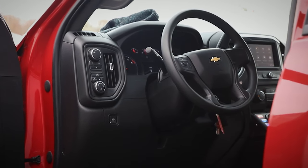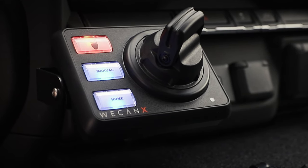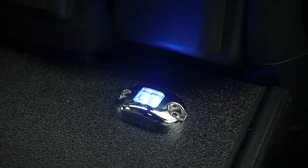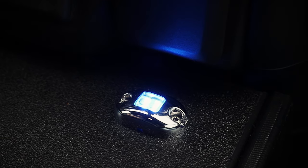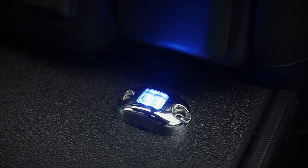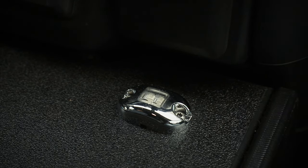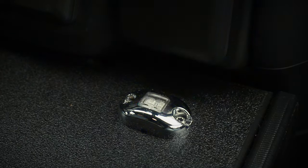Taking a look at the front cabin area, we installed Sound Off signal dome lights in the front and back. They're red and white with their own individual switches. We have our Whelen Argus controller, a custom-designed HDPE console, and a compartment door open indicator. What was nice with the Blueprint system is we're able to program the light to function differently. It does a steady on when the truck's parked, so it's not an eyesore or distracting for anybody sitting in the truck, it's just on. But if you put the truck into drive, the light starts to flash and becomes more visible to the driver, so they know that one of the compartments is open. That's flexible and can be changed however the customer wants it set up.